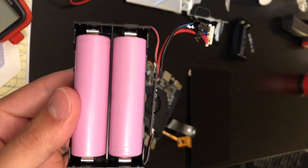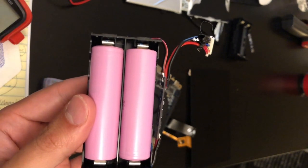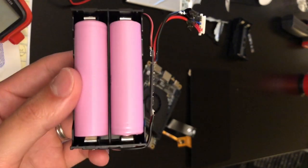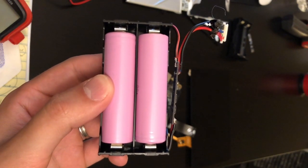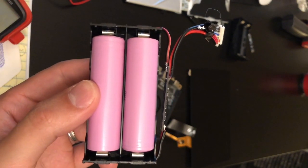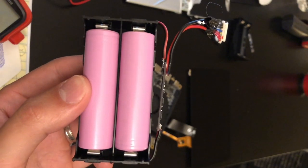Another thing I'm going to warn you about is the battery level. When you use a battery pack like this, it's not the same as a laptop, which has a finely tuned battery pack and an I2C connection to provide feedback to the computer about the battery level. It is not going to be that accurate. It will take a few cycles of fully charging and discharging in Windows for Windows to get a good idea of what the battery is like, but it isn't going to be perfect. There are a couple of other quirks we'll need to go over along the way.